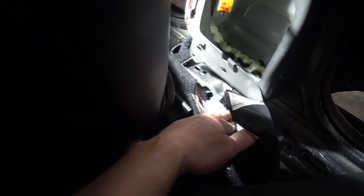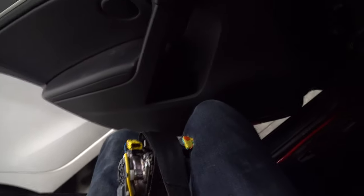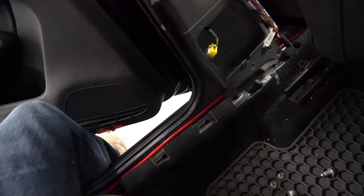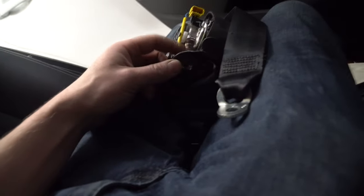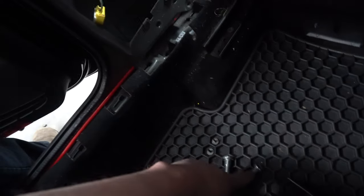All I did is loosen one side, left one bolt out, and then down here is your last one — another triple square. Take that last triple square out and then our belt is free. When you go to put your new seat belt on, it's quite easy. You're going to see that you have three different bolts there. Make sure that you feed your seat belt all the way around. The little bolt right here ties through and locks into the metal — you'll see where it's gouged in from tying into the seat belt because it goes through the metal and ties into the seat buckle, and then these little teeth lock in. This one goes through the actual plastic buckle part up here, and then this metal buckle gets this one which goes down at the bottom.